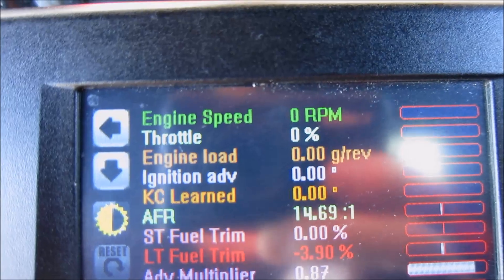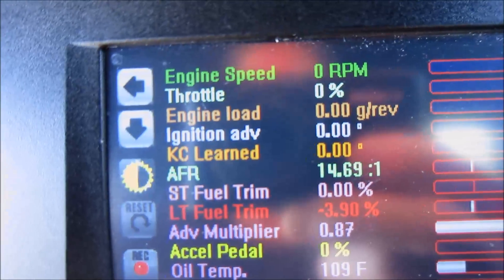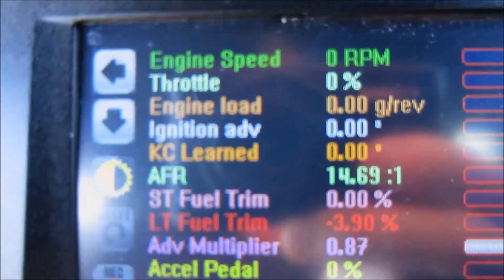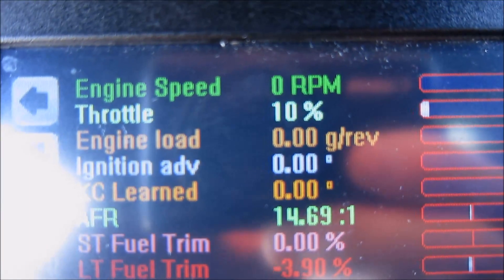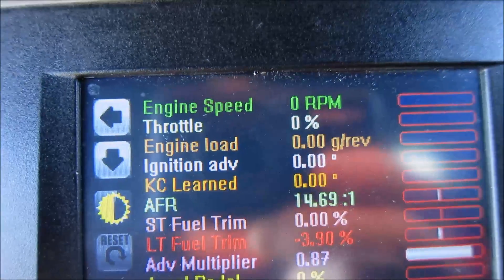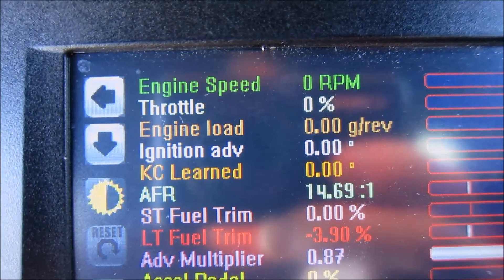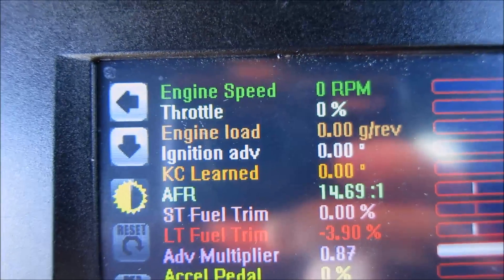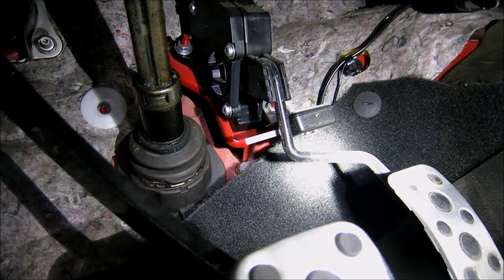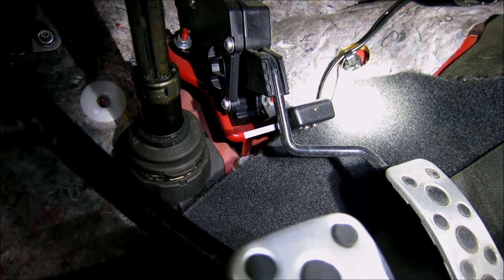As I press on the throttle, you can see how that value goes up. I don't know if you heard that, but that was the electric supercharger activating the first stage — the 2 PSI stage. Now if I look at where it's activating — that's part of our problem. The activation switch has probably moved a little bit. It's actually activating at 40% throttle, which is not recommended at all. So the fact that it's activating at around 40% means it's moved on its bracket, which shows you one of the drawbacks of having a mechanical position switch.